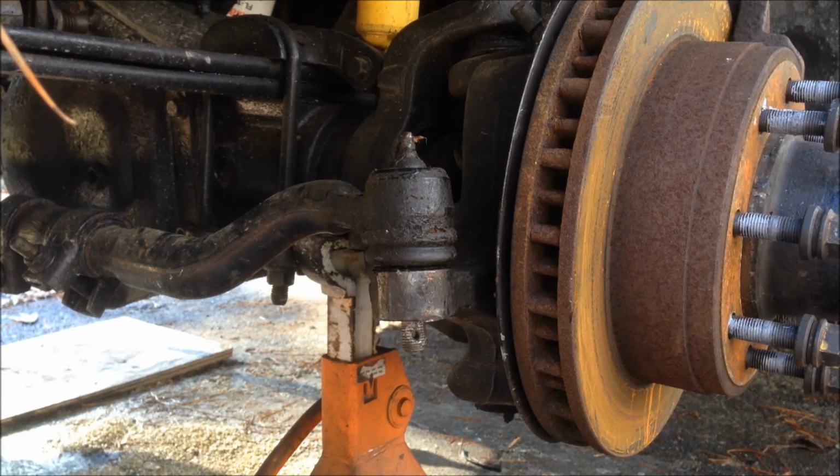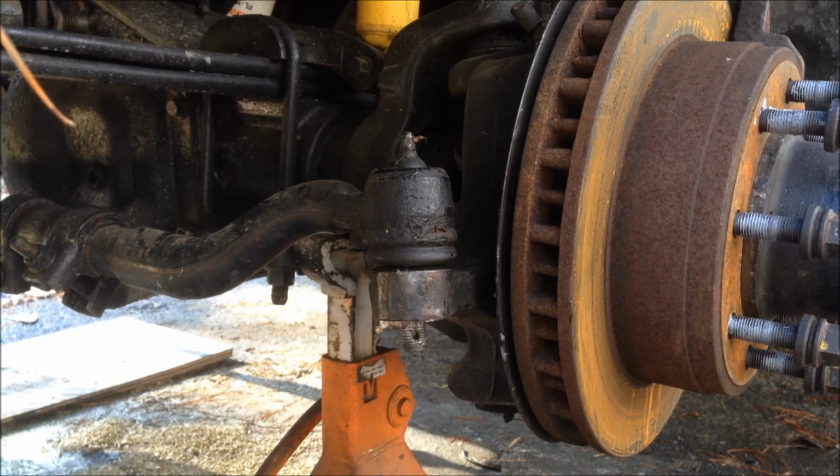Now the next one is the ball joint friction. So you may question, what does ball joint friction have to do with the steering system? Well, on a lot of the Fords, the actual upper and lower ball joints do not come with a Zerk fitting. So those ball joints become dry, and as a result there's just too much friction at the joint. You can imagine your truck weighs somewhere right around 8,000 pounds, and the weight distribution is typically about 70% front, 30% rear. So let's just say there's 5,000 pounds in the front, and each one of the spindles is supporting something on the order of 2,500 pounds. If you have a steel-on-steel dry ball joint, it's going to take a lot of effort to turn the wheel, and that additional friction is going to exacerbate the backlash in your entire steering system.